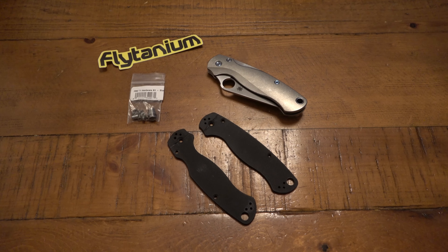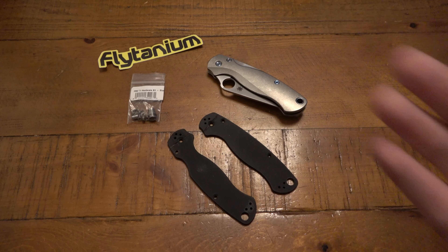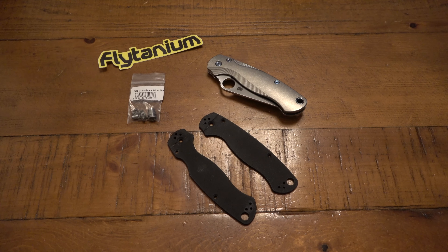If you haven't checked it out, check out Flytanium — they have some pretty cool aftermarket parts. I did a video on this and got a bunch of messages from people asking me to make a video on the knife, so that's what this is — but it's more or less me telling a story. I thought it would be boring if I just put it together on camera since you've seen that before. In fact, the last project I did I stripped out the screw on the Minimalist. So I have to really just slow down, pay attention, and hit those pivots with some heat to make sure the Loctite from the factory is loosened up before trying to unscrew them.